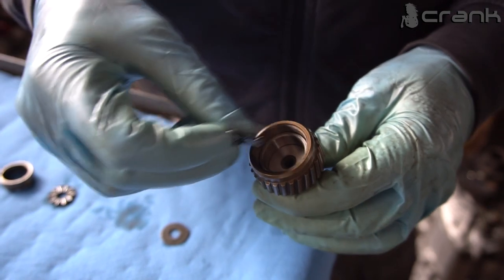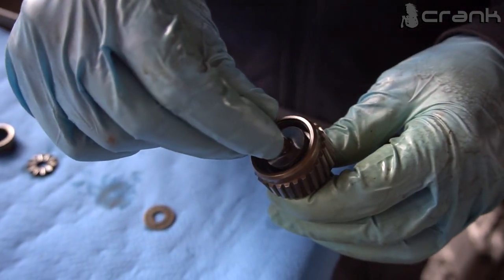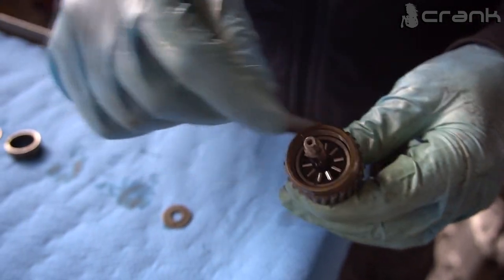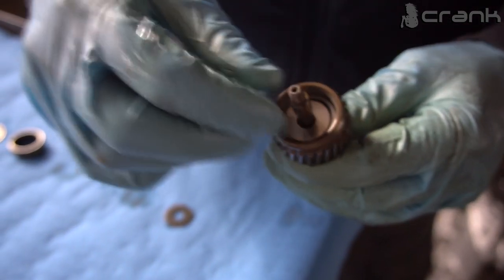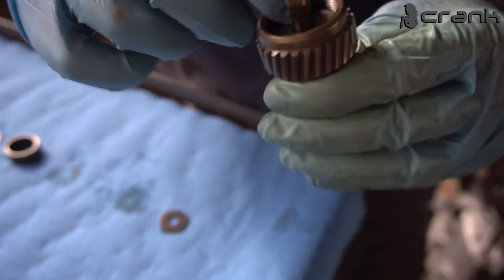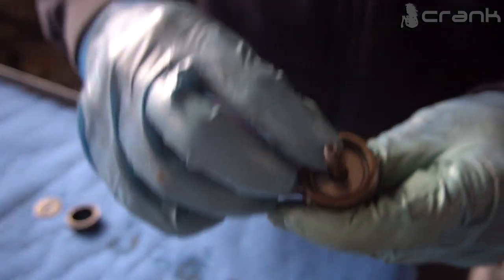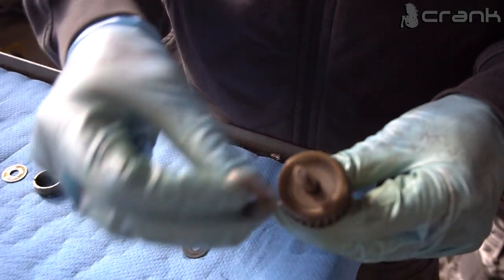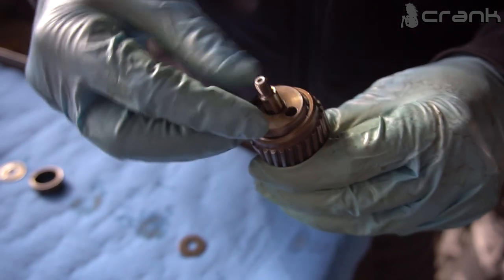After that is one of the bearings. After that is the shaft, like so. The other bearing. Yeah, I have cleaned the shaft also. And the last shim. Like that. And now, oops, I have some debris here. And now I'm going to install the cup without thread locker, just to see how it feels.